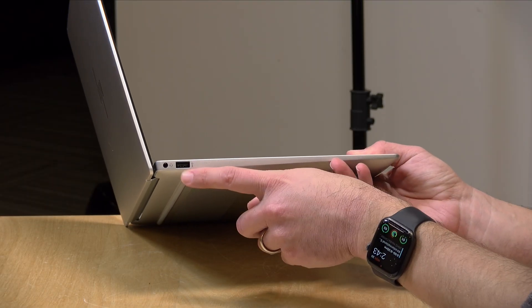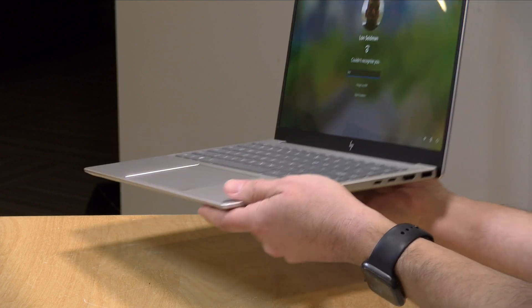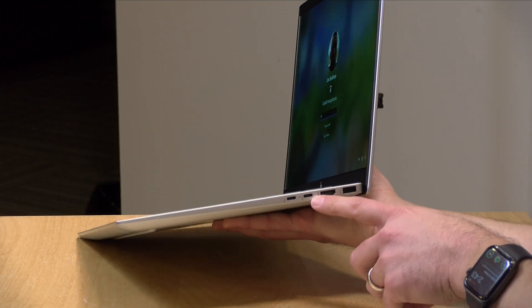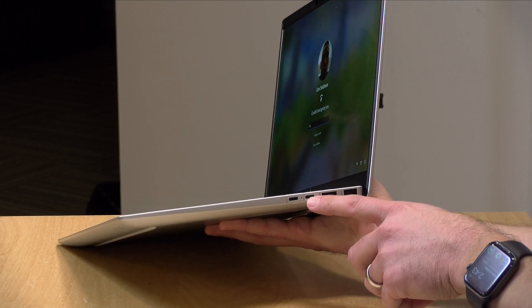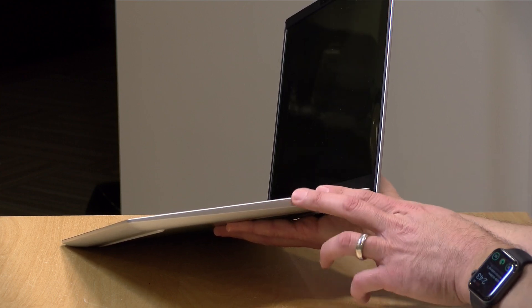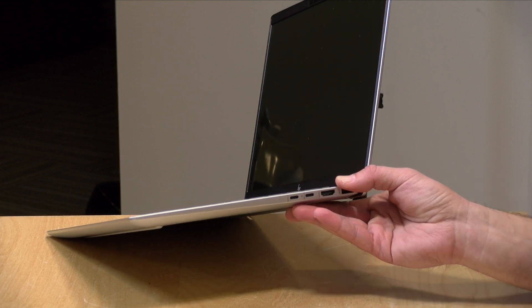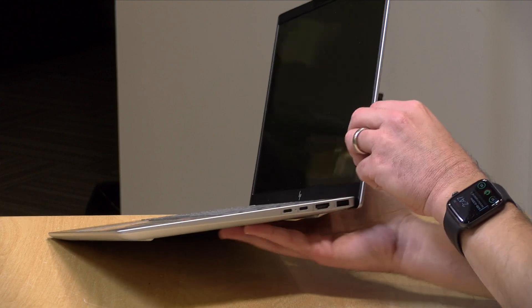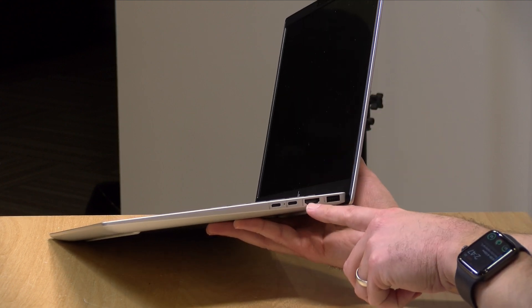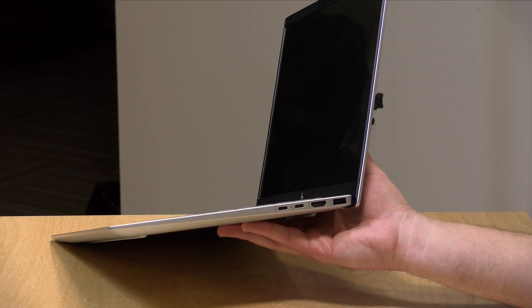You don't have many ports on this one. On the left-hand side you have a USB-A port along with a headphone/microphone jack. On the other side you have two USB Type-C ports — these are not USB 4 ports, so no Thunderbolt, but they do support USB 3.2 Gen 2 at 10 gigabits per second. Both USB-C ports are full service: power in, video out, and data. There's also a full-size HDMI 2.1 port supporting 4K output, and another USB-A port.